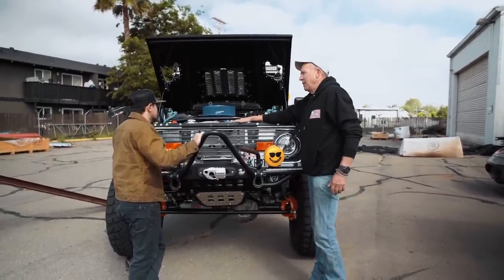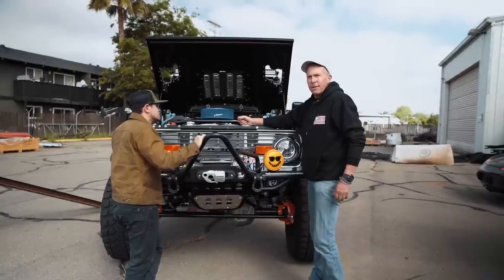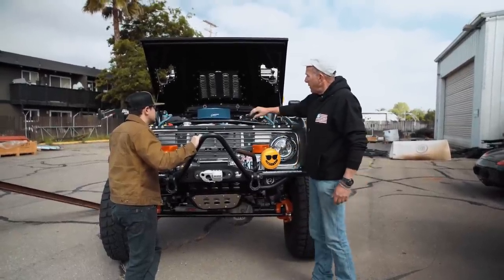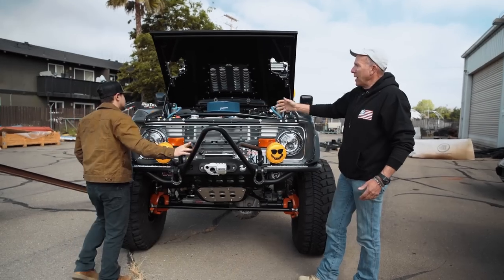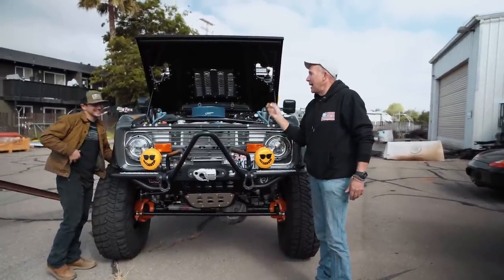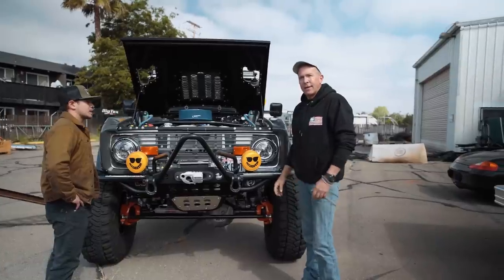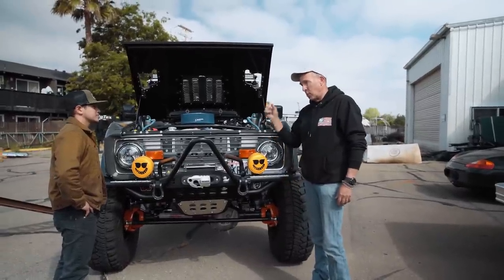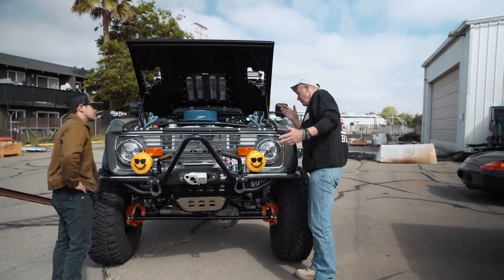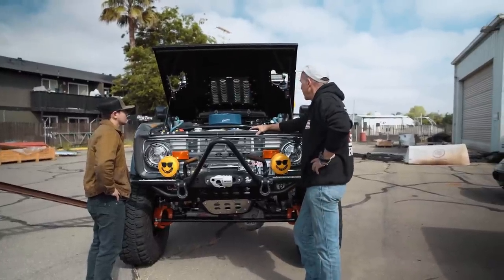I've got a little bit of a different radiator. John and Rhonda from JB Fab have the same radiator — a Ron Davis — in Bad Pony, and John told me it cools their twin turbo 427, so I had Ron Davis build me one. I could have dropped the radiator in as-is but I only had about a quarter-inch clearance if I ever needed to change a belt on the trail, and I've got a serpentine belt setup now — if you've got to change a serpentine on the trail, that's trouble. So I wound up cutting the core support and moved the radiator forward three quarters of an inch. Fitech did the EFI — their Go 400 Power Adder, which is for supercharged or blown engines or gnarly cam setups.